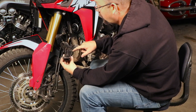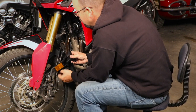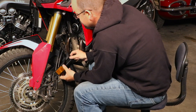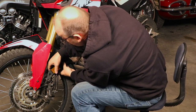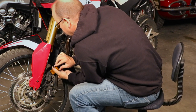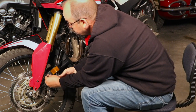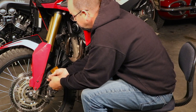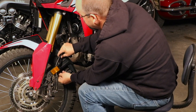The retainer has about five or six little snap-ins. What I found works best is making sure all the lines are going through the pre-cut locations first. The little guy in the corner needs to go in first — sneak that in, put it up over the top, making sure everything is lined up. Then put the bolt back in and snug it up. Make sure all hoses are going through their locations.